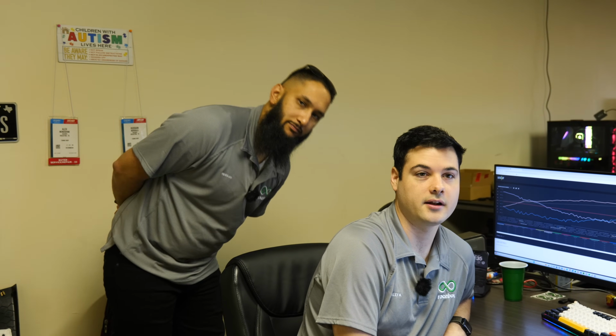We ran this car on the dotted line, didn't we? It was less than an eighth of a tank. We did 740 horsepower at less than an eighth of a tank. As a safety standpoint, it's worth it in a lot of ways. Even if you're not pushing anywhere near those numbers, it eliminates fuel cuts. You don't have to worry about having more than half a tank, or feeling for a fuel cut. It's also a very clean pump. Makes you feel like a Q50 is a premium product.